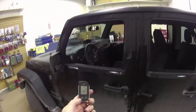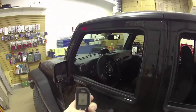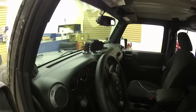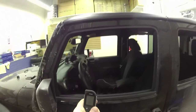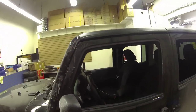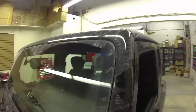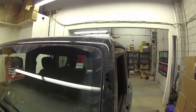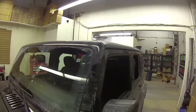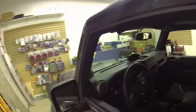So let me show you how this system works. If I hit lock, it basically locks the doors and arms the OEM alarm. You can see the red indicator light indicates the OEM alarm is armed. That beeping you're hearing is the remote has a low battery — it is USB rechargeable, a little micro USB port. We mounted the vehicle antenna for the alarm up in the corner there. The antenna has a blue LED, which basically warns thieves away to indicate that it has an aftermarket alarm.